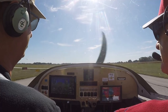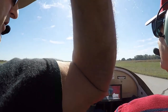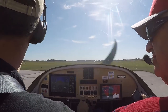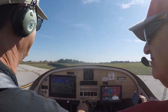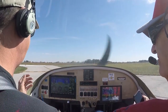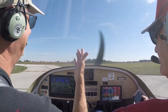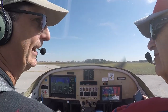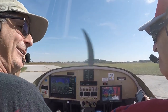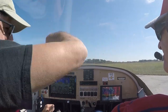End of runway — this is where we do some last-minute checks. The one thing we make sure we do: I check this about a dozen times every time I fly — make sure that canopy is latched. A lot of people forget to latch it, get about halfway down the runway or even up in the air, it lifts up, makes a horrible racket, and they end up crashing trying to close it. So if the canopy ever pops open, just let it be, turn around, come back and land. Don't try to fix it in the air — it's a wing, Bernoulli is lifting that canopy far more than you can.